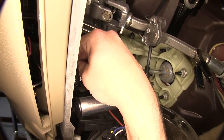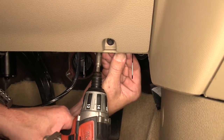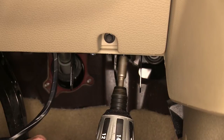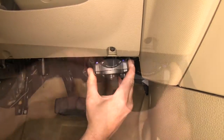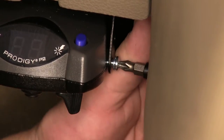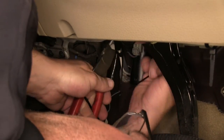We'll return to the brake controller and plug into the connector. Next we'll go ahead and mount the brake controller bracket. Using a couple of self-tapping screws, we can mount it here to the bottom of the dash on the metal piece of trim that runs underneath. With our bracket mounted, we'll go ahead and take our brake controller pigtail and plug it into the back of our brake controller. We'll then take the two screws provided with the brake controller install kit and secure the brake controller to the bracket. We'll clean up the install look by securing our wires up underneath the dash.